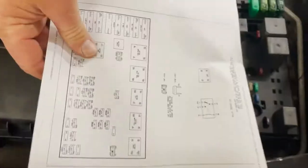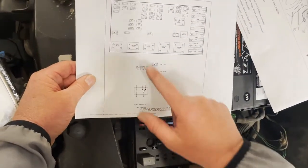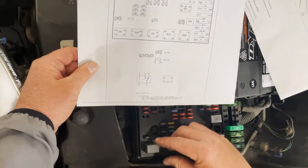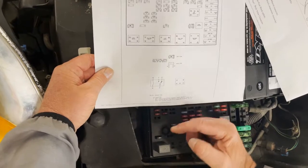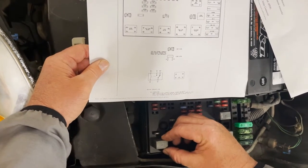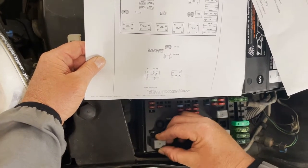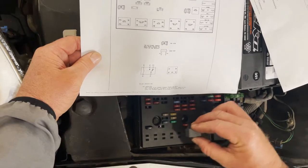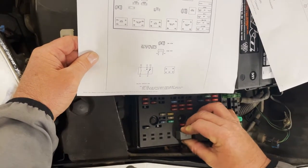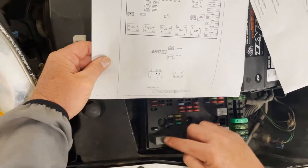The map on the power distribution box needs to match the wiring schematic horizontally. Here's the horn relay on the schematic, and here's the horn relay on the car — and it's loose. I really think the problem is not the relay itself but the connection, because it's loose inside the power distribution box. Putting in another one, it's much tighter, so I think we have some loose connections. We're going to test this relay to determine if it's good or bad.